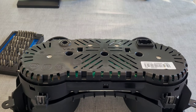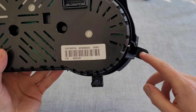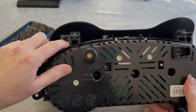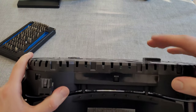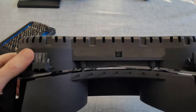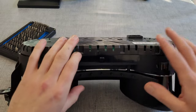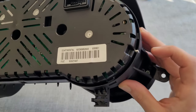This bit is a lot easier if you've got a second pair of hands. There are eight screws altogether. The first six aren't too bad to get to - you've got one there and it's mirrored on the other side. Correction: they're not T30 they're T25 to take this off, and these smaller bits are T10. You've got one here again mirrored at the top, then those two - so there's your first six. The other two come from the back but they're behind here - you need to take your actual dial cluster out to get to those two.